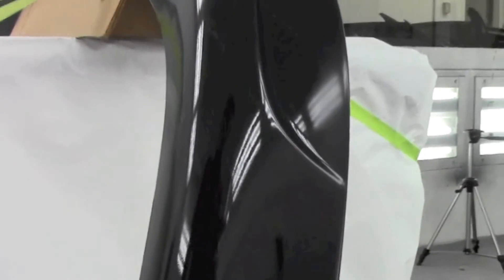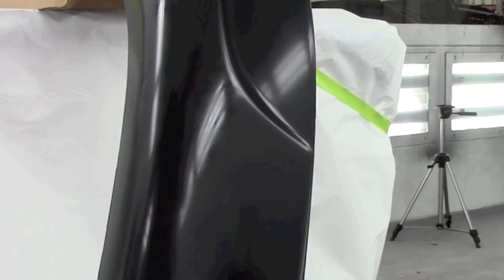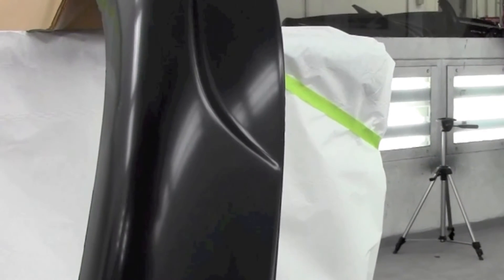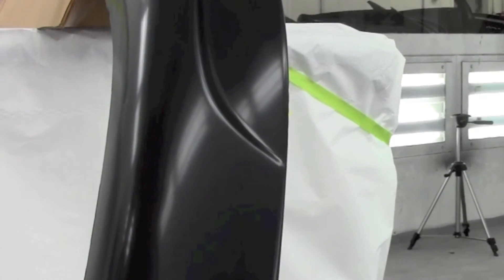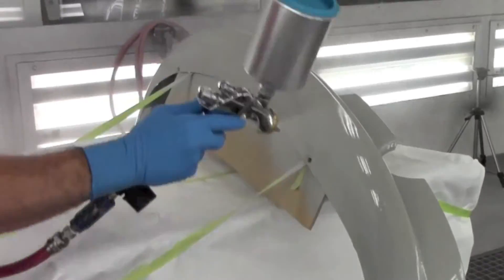A lot can be learned by watching it flash. As you can see in this clip, it's getting duller and duller but still maintaining a uniform coat. That's important because we want it to be wet on the surface — the chemicals will do their job, and we know the subsequent adhesion and topcoat system is going to be very good performing. Once we let that dry, we can go over it with, in this case, a gray sealer, and just lay that out as a single coat.